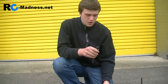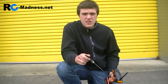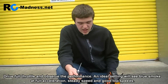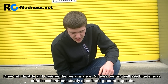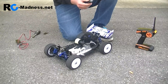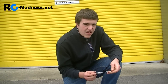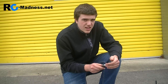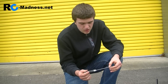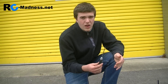Once it's warmed up, we can start tuning. Basically all you need to do is drive up and down at full throttle, observing what the smoke is like, what it sounds like, and of course most importantly what the performance is like. You should be seeing a fair amount of blue exhaust smoke coming out of the exhaust pipe, a high pitched noise, but no bogging down at all. If it bogs down then that means you are too rich. Lean is clockwise and rich is counterclockwise. Rich means adding more fuel and less air; lean means adding more air and less fuel.